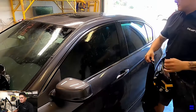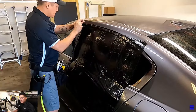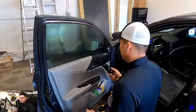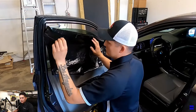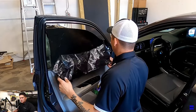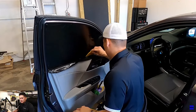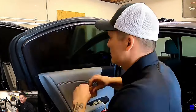When you do a trash bag like this, you have two sides because trash bags have two sides — just go ahead and throw it in the car. Repeat the process for the back door and for the back quarter. Back quarters, same concept — we're looking for overlapping, overlapping the edges. We're going to wet the glass down and overlay the trash bag over the top edge by about two inches or so. Cut it big. Make sure it's overlapping on the sides as well. Once you get the top up, roll it all the way up and wet down the glass. This is just regular soapy water. Take a credit card or a hard card and tuck the edges all the way to the edge. This preps us for removal.